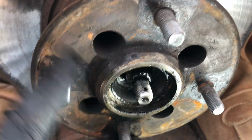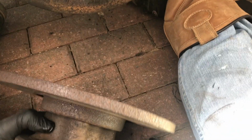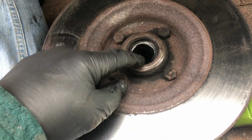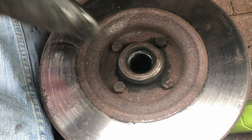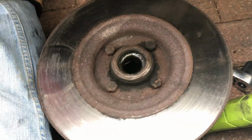There'll be an inner bearing in a minute that will come off. Hopefully this won't fall on my legs. There we go, it's off. Houston, we have a problem. Okay, so that's a stud axle left behind, and in here you will see in the hub we have the disc attached. If I can just drop it down again without getting into trouble for messing up the drive. And there we are, those are the 4 bolts that have got to come off. Those hold the disc to the hub, which we couldn't get to before. And then inside here you can just see there's a bearing race. Can you see that? That's again the conical going the other way to the front one I just showed you, and that will allow the wheel and the hub to rotate. So we've got to get that out in a minute, drift that out and put a new one in.